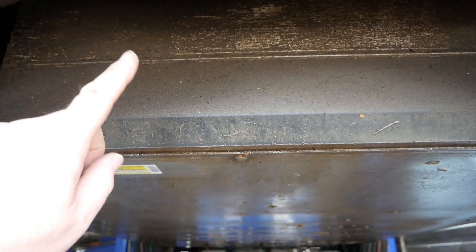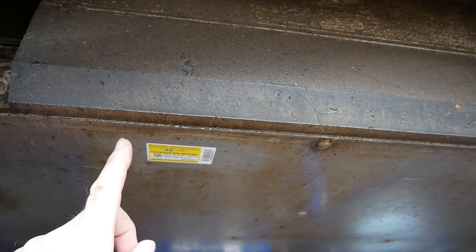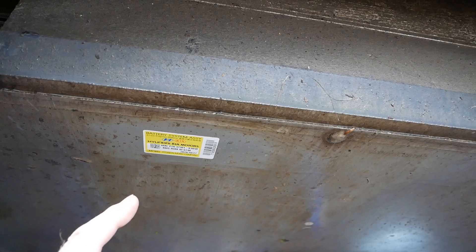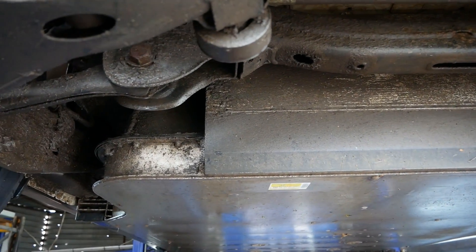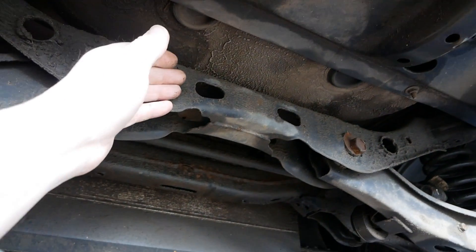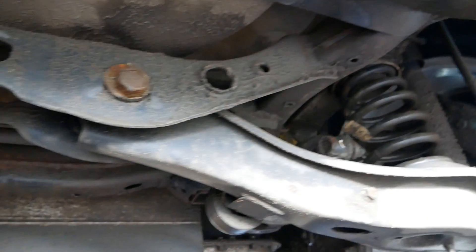This particular car had a replacement battery a couple of years ago. These batteries are made by LG Chem and had an issue — some Konas and all GM Bolts in America were recalled because they use similar or the same cells. This battery was replaced under warranty during that mass recall. The battery is one single large pack, and there's nothing under the boot behind the rear axle, unlike the Ioniq.